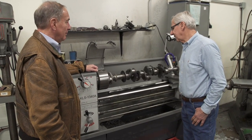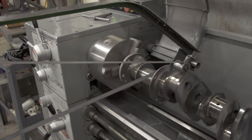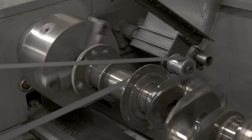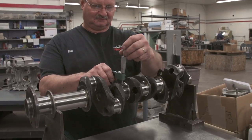What he's getting ready for now is to polish the crankshaft so that we can get a good dimensional check on it. After it's polished, we'll dimensionally check the crankshaft. I hear the words 'engine overhaul to new factory tolerances' — that's what these things are checked for.